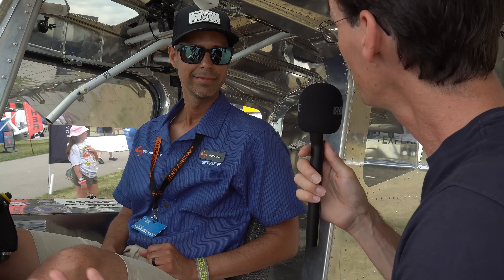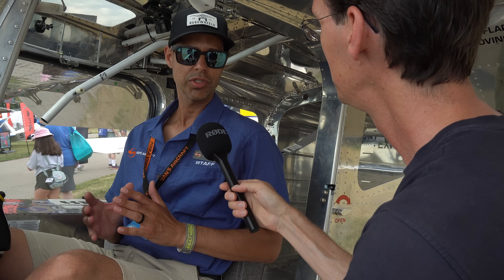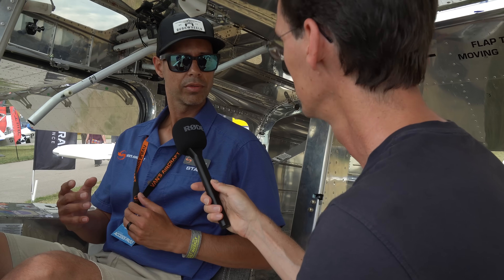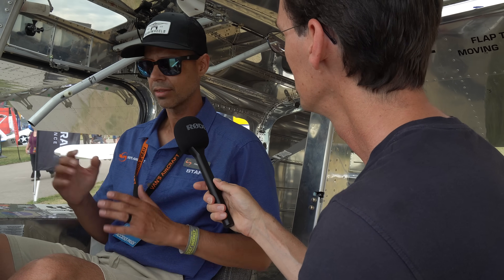I am the lucky person. How has it changed from first flight to now? The biggest changes are in control forces and some of the handling. At the beginning, our control forces for pitch and the rudder were really light, similar to what you'd expect in an aerobatic aircraft. This being more of a utility-type aircraft, we wanted it to be stable with a little more feedback on the controls. So we went through a series of flight tests to increase those forces. Having a flying tail makes it complicated to get that feeling just right — the RV feeling — everything harmonized, light forces but stable.